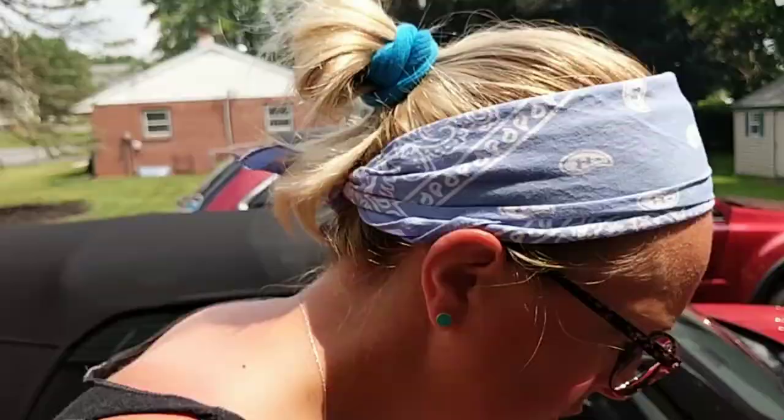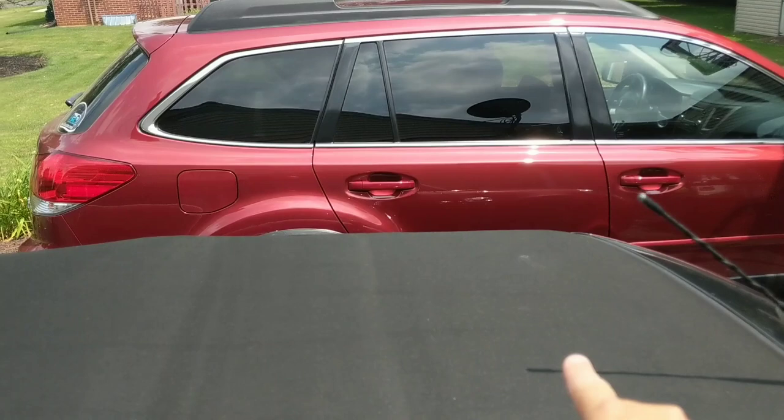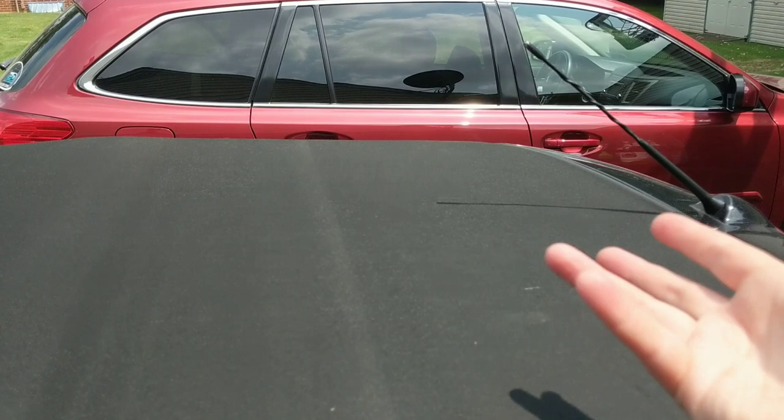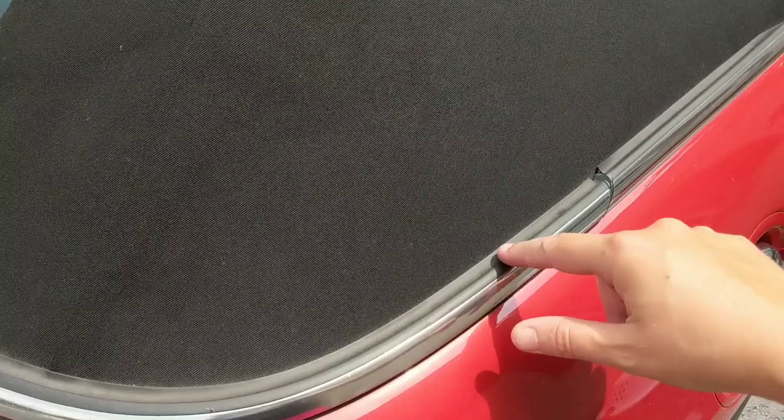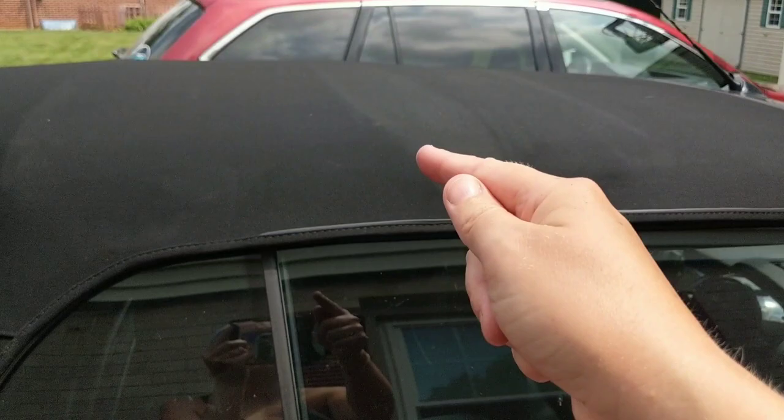You can see just by vacuuming alone we made a big difference. Even the mud and the bird poop on the top we were able to vacuum up — it's essentially dry soiling. Just like any shampoo job on a vehicle interior, you want to get up as much loose, dry soil as possible before you wet it — less chance of creating wicking or a ripple effect. Now we're going to be very careful around the glass and the seals.